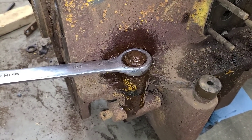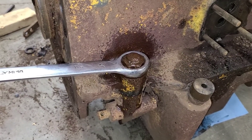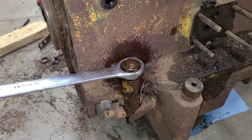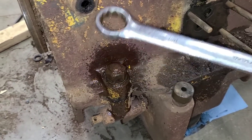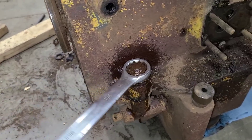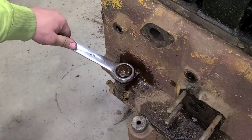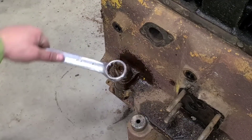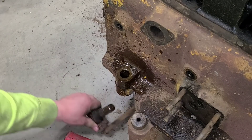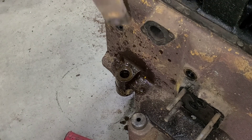I brought the inch and 5/16ths over and it was way loose, so I figured I'd try an inch and a quarter — and an inch and a quarter fits nice. What I've been doing to just get them broke loose was just hitting them with a hammer. After spraying just a little bit of lubricant in there since the threads are rusty, I came over to this side. I don't get it — I fought and fought the other side, and it's like someone's had this side apart recently. I cannot explain this, I'll take it though. After fighting the other side, this is a lot easier. And this one's straight, so I'm not sure if this one was replaced.